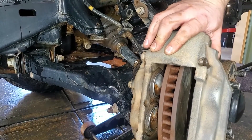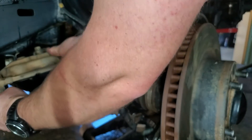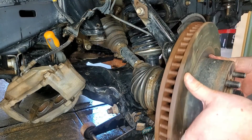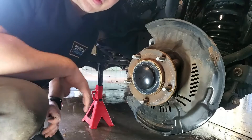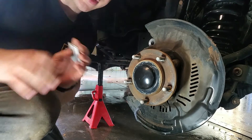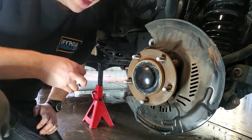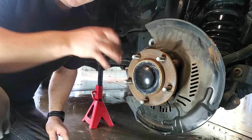You can now simply slide out the old brake pads to make way for the new ones. Remove the caliper away from the hub and push it all the way to the lower control arm. You can put a screwdriver through one of the caliper bolt holes and into the hole on the lower control arm — it holds the caliper out of the way with no strain on the brake line. Now you can simply take the rotor off the hub. To make sure the new brake rotors don't warp, we need to make sure the two mating surfaces are as smooth and clean as possible — where the studs are coming out. I'm going to clean it back with some emery paper to make sure this is a nice clean surface, then we can stick the rotor on.